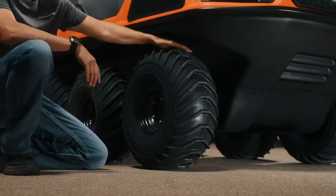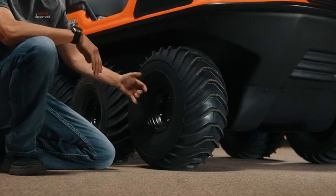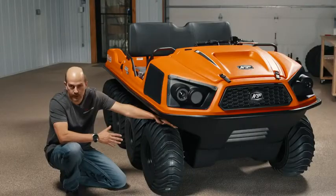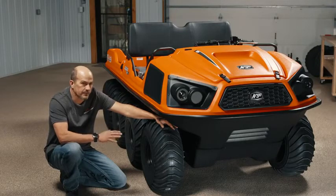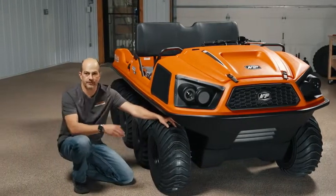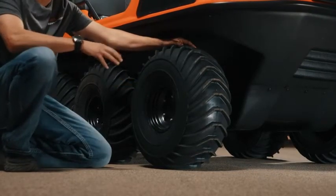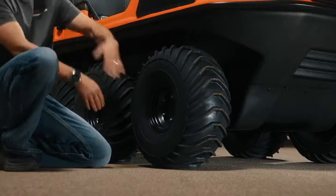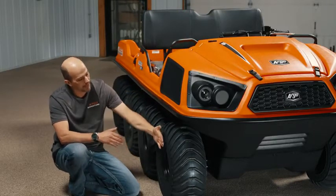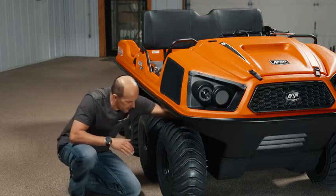The Frontier comes standard with a 24-inch tall by 10-inch wide tire sitting on an 8-inch steel offset rim. Depending on the gear ratio of the transmission, you're going to run 18 to 22 miles per hour in high range. Low range and reverse is going to be probably 10 to 15 miles per hour. On all the newer models, there's a valve stem on both sides of the rim. If you were going to run tracks, you can take this tire, flip it upside down, and swap it with the one on the other side, which allows the wheel to come out about two to two and a half inches, giving you adequate clearance so the track doesn't rub against your body.